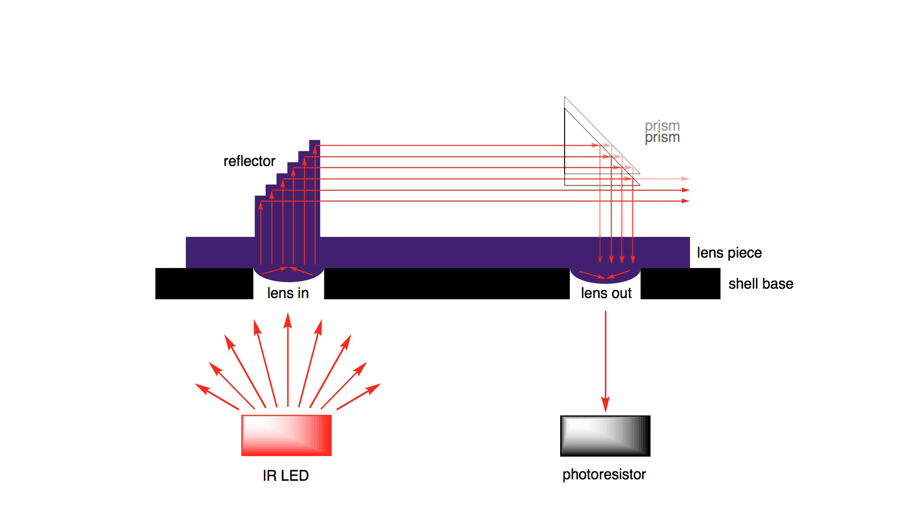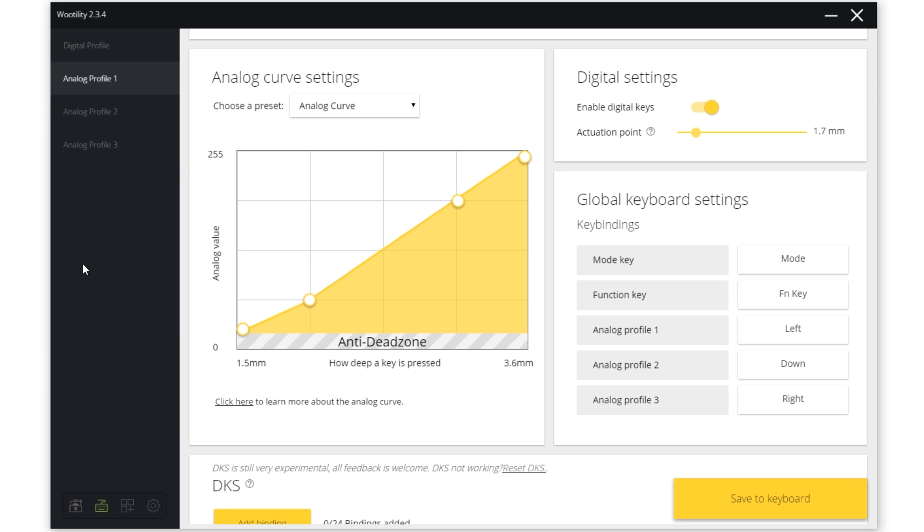Although they could not provide me with an output distance plot, I suspect the output is not stepped as some might expect, as the light is not a laser and is both scattered and partly out of phase, so the signal build-up should be smooth rather than staggered, I think. I have no idea if the output signal actually builds up linearly either, but it doesn't really matter because the keyboard can be calibrated to convert any curve to linear, and in fact the Wooting software allows the user to define other patterns than linear as well, although all patterns are still bound by the analog working range.